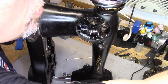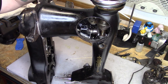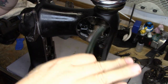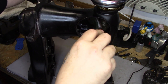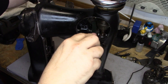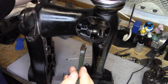I'm going to switch over to a brush — let's see if I can get some of the smaller stuff now. An old toothbrush will work; I'm using a gun cleaning brush — same concept. I'm doing it to knock crud down, working from a high spot down to a low spot. Now I've got the machine sitting on her nose, so start at the high end of the machine when you're knocking schmoo off so it falls lower. Use gravity to your advantage, and use every orifice you can to get in and get crap out of there.